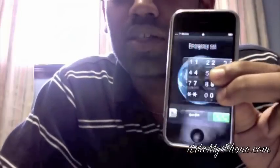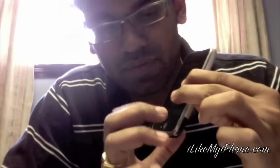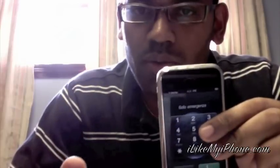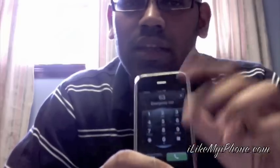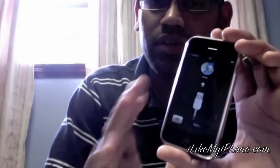We got back to where we initially started. If you replay this video you'll see that we got into restore mode — which is used for changing firmware — and then we got out of restore mode by just holding the home and power buttons and then releasing the power button while still holding the home button. You don't really have to do the full restore process to get out of restore mode.